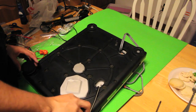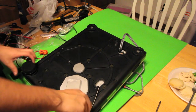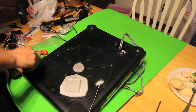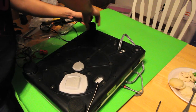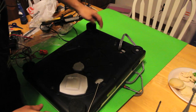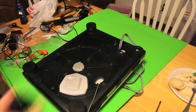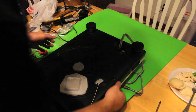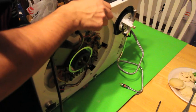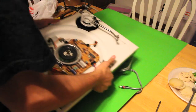While I do this, I just want to tell you: once you put it together, the best way to test it is playing a record. If you don't have a record, you can hook it up to Virtual DJ, Serato, or whatever and just read to make sure it's not jumping, then let the record play all the way through. Make sure the tone arm doesn't get caught or anything. If you accidentally messed up your anti-skate — which happens — you can open it all back up and fix it, or as long as it's on zero you'll be good.